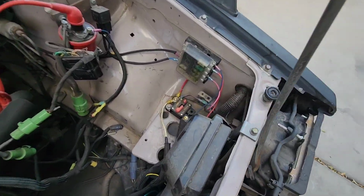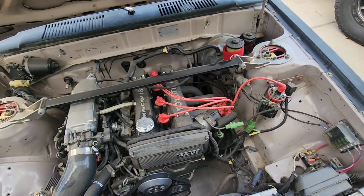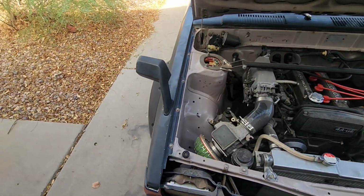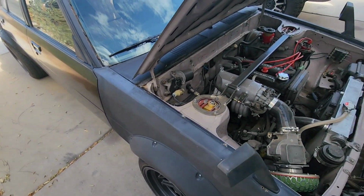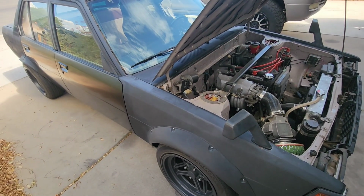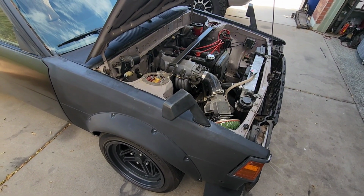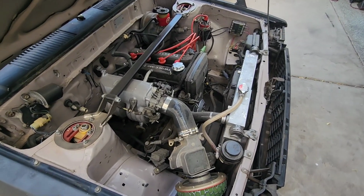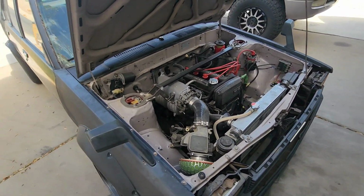As you can see, there's some DIY wiring to power everything up and make everything work. It's basically a plug and play kind of setup with the harness. The harness only needs about 3 wires, so those are just separate, and they basically just need power. So you just power the harness, ECU, and make sure your grounds are good. Yeah, and your EFI in an older Corolla.